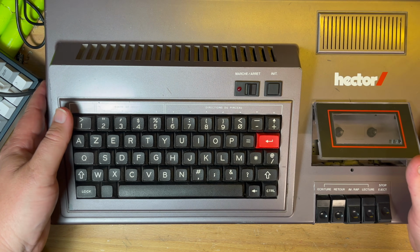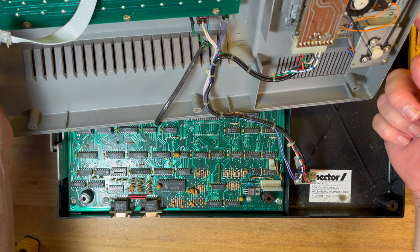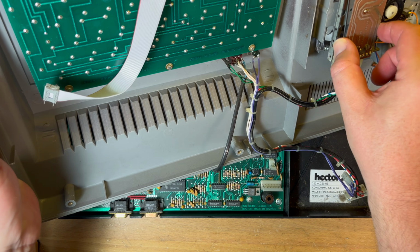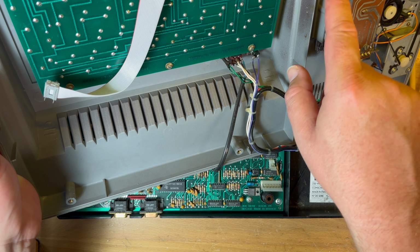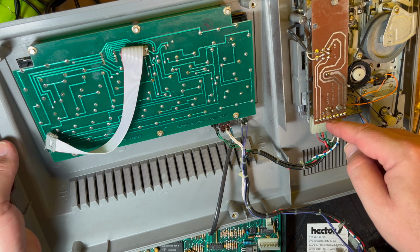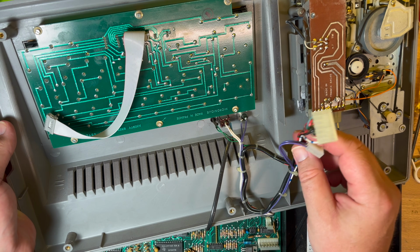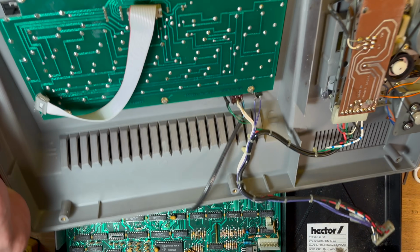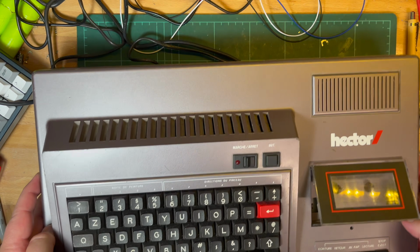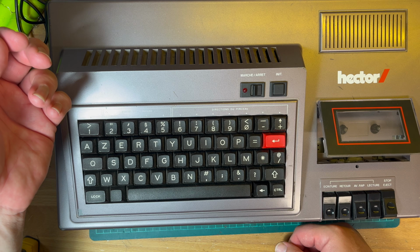And to load software, what I've done on the Thomson machines is I've added a 3.5mm audio socket. So this is obviously where the data's coming out here, I assume. So yep, data's coming in here from the tape head. Sorry, you can't see that. And then I'm guessing it's coming out here to the computer, maybe. Or is this power as well? This is a mixture of power, I guess, and anyway, I'll pull all that apart and have a proper look. But yeah, add a 3.5mm, there's plenty of room. I had a 3.5mm socket, so I can try and play WAV files directly into it if I can find any. I certainly don't have any tape software, so yeah, okay.